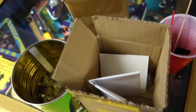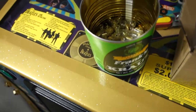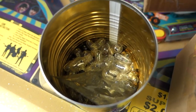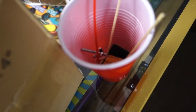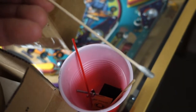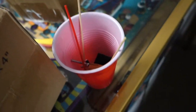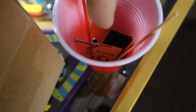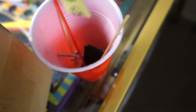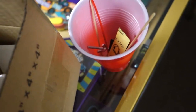These little boxes from Comet are great for holding little things. Sauerkraut — I love sauerkraut, it's good for holding your bulbs when you take them out. Little Dixie cups — you'd be amazed how much use you can get out of them. I keep extra cotton swabs in one, and once I use them for cleaning I cut the ends off and use the stems for filling stripped-out holes in the playfield. Extra little pieces of sanding paper — I fold them in half the long way and that's how I clean the contacts.